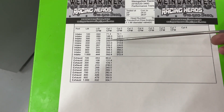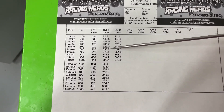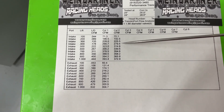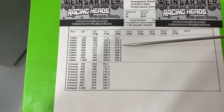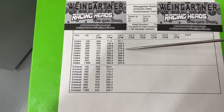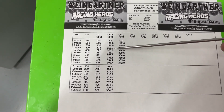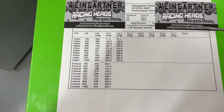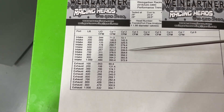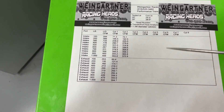We did something kind of weird on the exhaust side, but the intake was pretty consistent. The numbers I really care about are 400, 600, and peak. At 400, it's 291 on the long port and 280 on the short port — the short port is just not quite as good. At 600 it's 356 and 340, really good numbers, and it peaks at 800-900 lift at 394. Really good flowing head for this bore size.